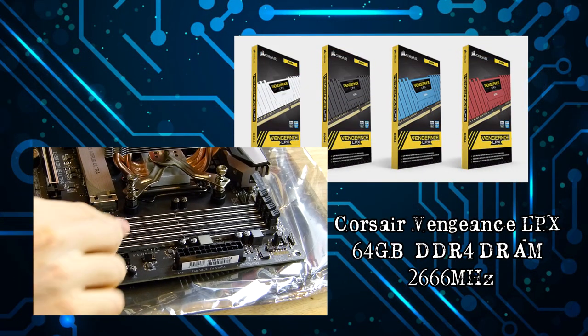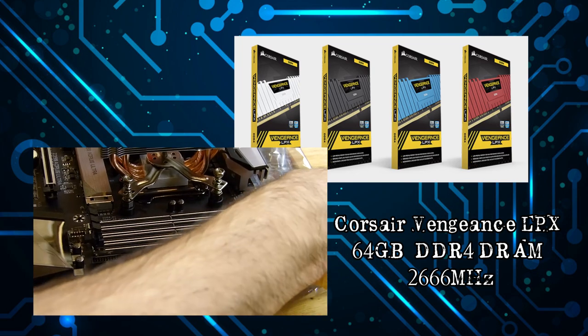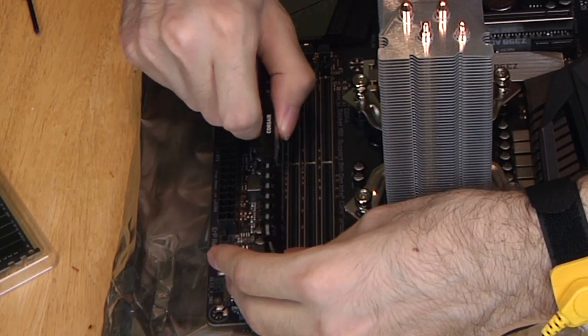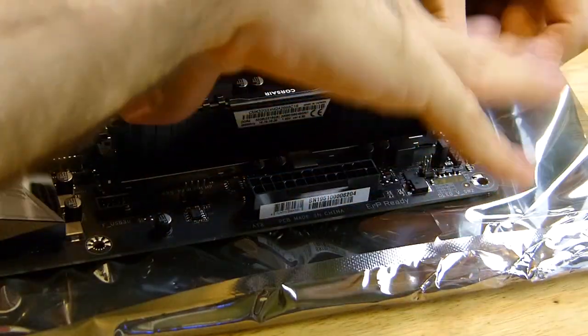The Pro and Ultra boards support up to 64GB of DDR4 RAM. From my uses in the past, I would easily max out my older PC's 24GB of RAM when rendering videos or when hosting game servers. Double check your board's max RAM and frequency when picking. Not all RAM is supported.